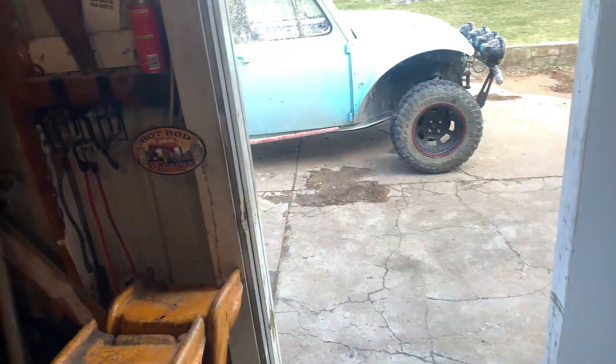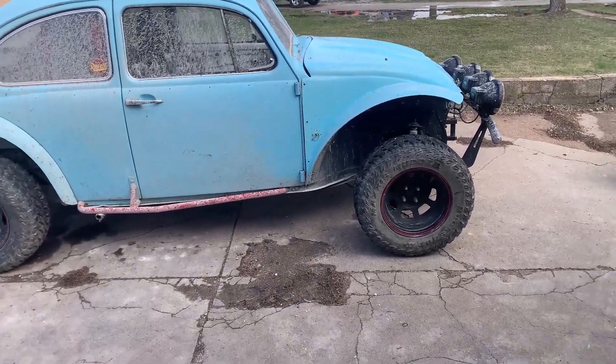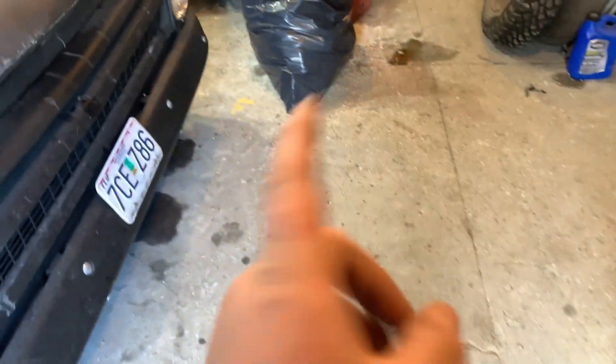Howdy doodly. This is literally the next day and I ain't finished with it. We gotta get more things welded — all the little holes on the inside. Probably put some body filler in some of the holes in the back because if I remember right there's foam behind the firewall area, and I don't want that to catch fire.